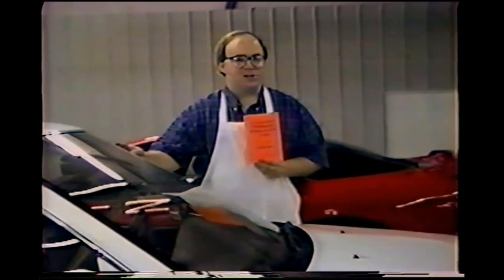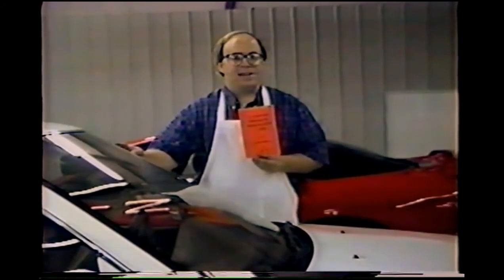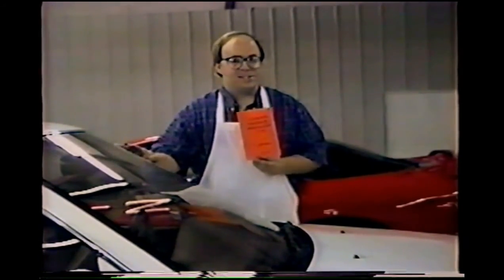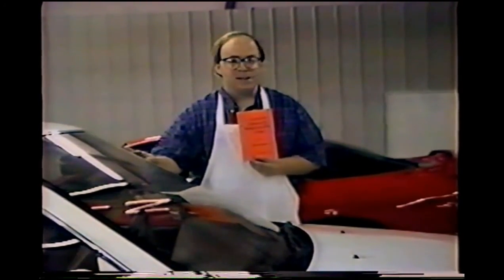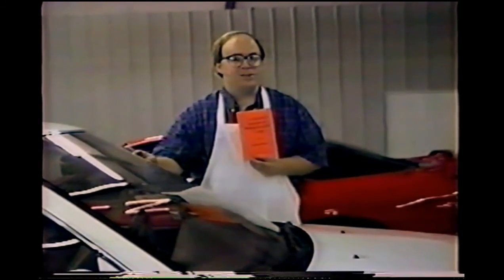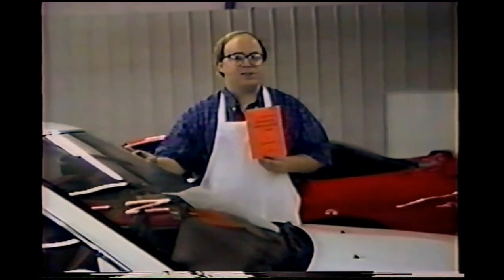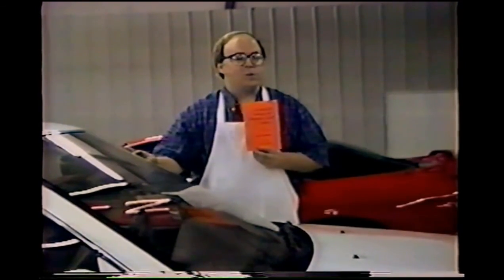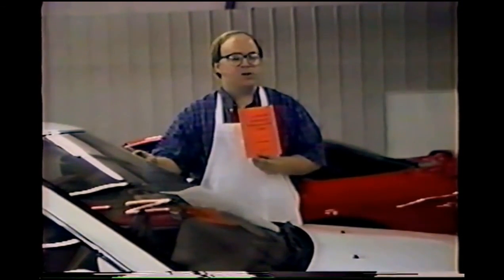And also, in conclusion, let me remind you: if you can't see a dent, you can't fix it. Adjust your lights as many times as it takes. If it takes 100 times to get the light right on the dent to where you can see where that tip is, move it 100 times. If you can't see it, you can't fix it. Concentrate on where your tip is, see it in the light, and work the metal from there.